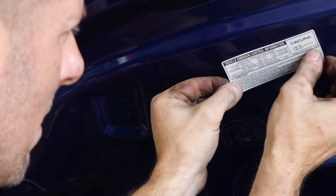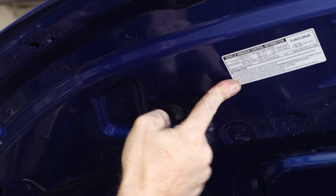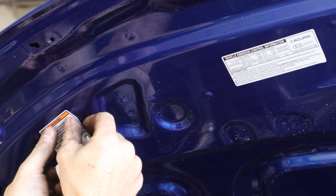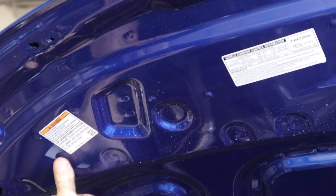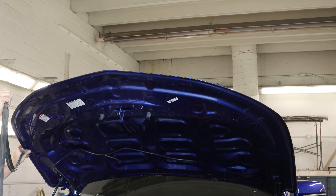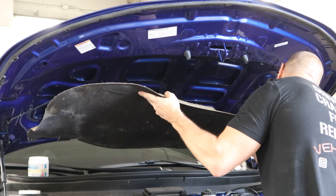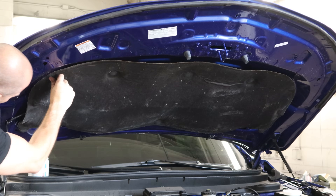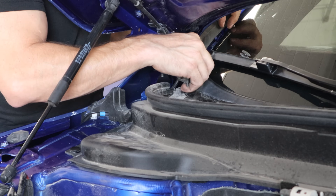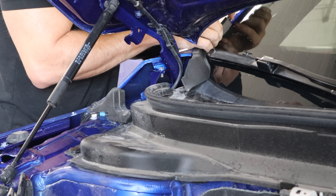When we put our stickers on, I was able to save this one off the original hood — just heat it up a little bit. I'd cut the outside of the skin off so I could get the front gasket off. This sticker I just went ahead and bought a new one because it only cost a dollar. Now we can put our front gasket on — these clips are not very friendly, that's why I cut the skin off, just to be able to get to the back of the clips and squeeze them, otherwise you will break every one of them. Plug our hood liner and the tabs in the back, then push the push pins in. These are pretty sorry hood liners — they don't last very long, they collect all the water and stretch and look horrible. And they're also on back order.